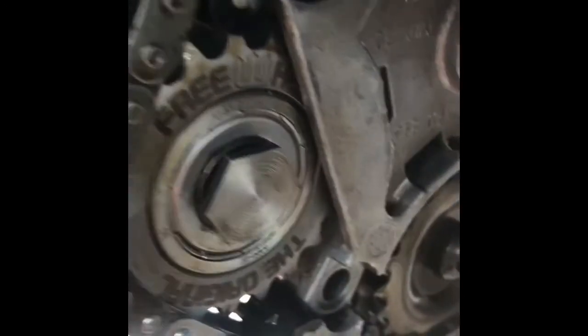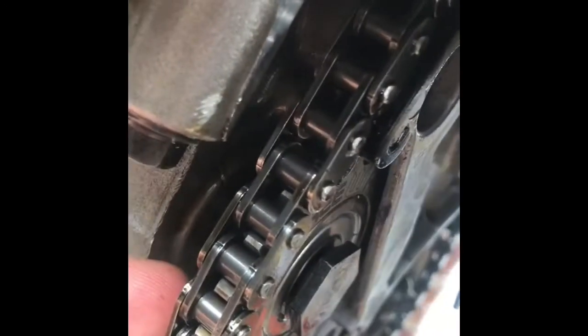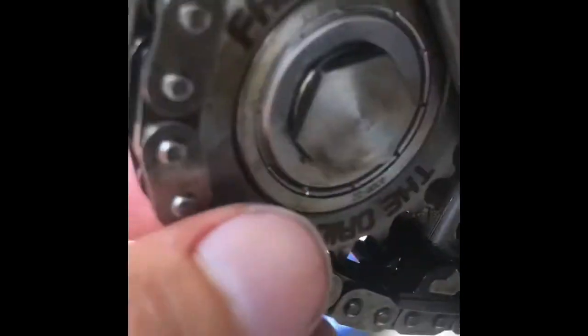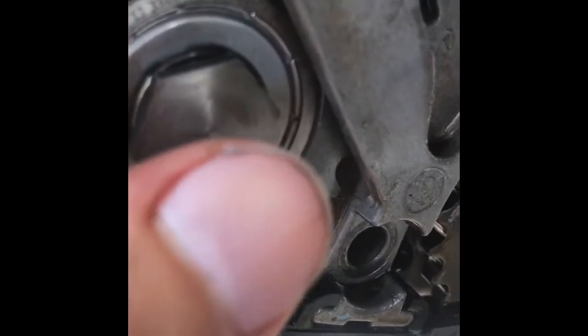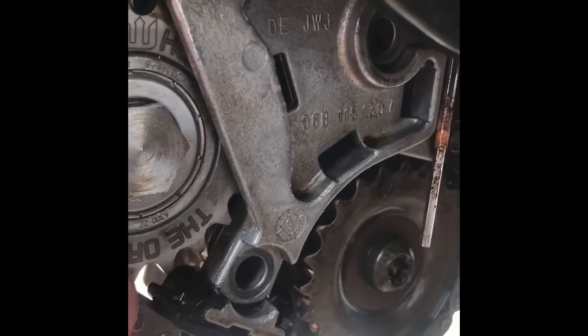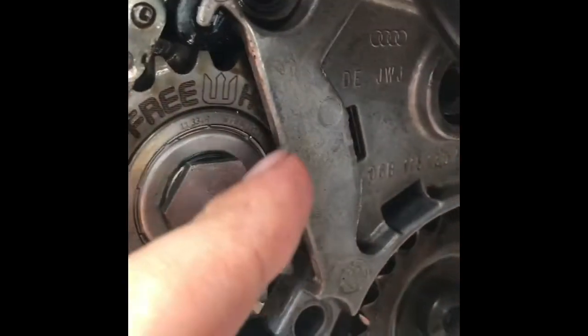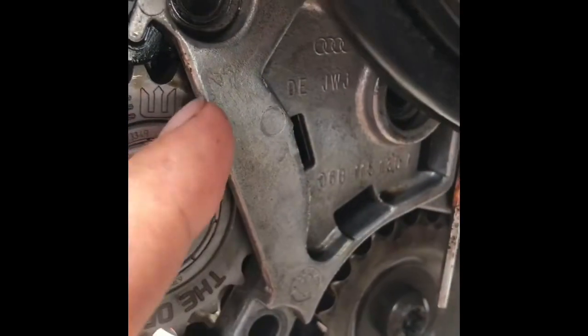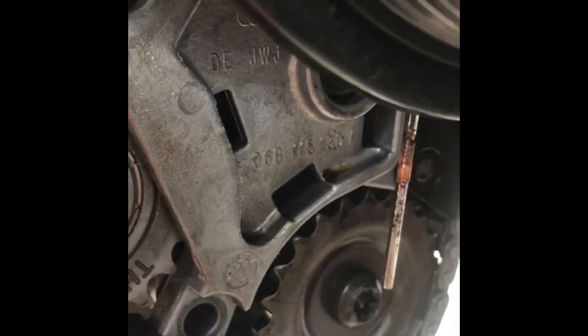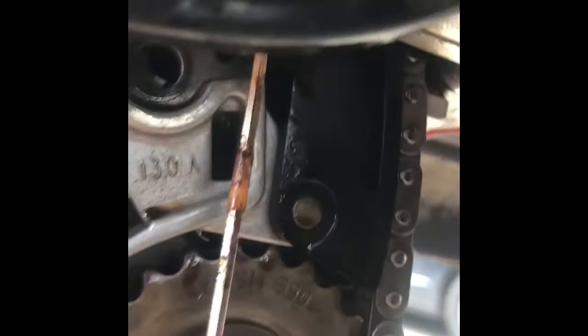I took the freewheel and the sprocket itself — took the sprocket and then a little spacer — holding both in my left hand. At the same time I sort of put it up there together with the tensioner assembly with my right hand, making sure you tuck this in here behind this edge so it fits nice in that little recess pocket. Once you do that and make sure your plastic chain guides are up in there good.